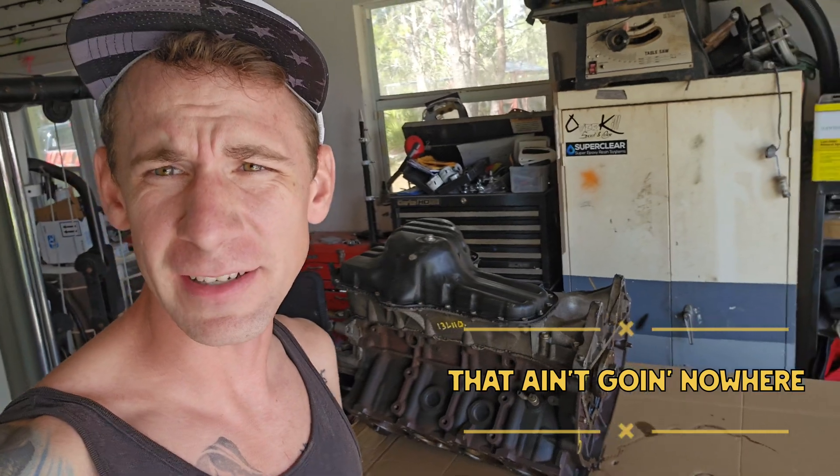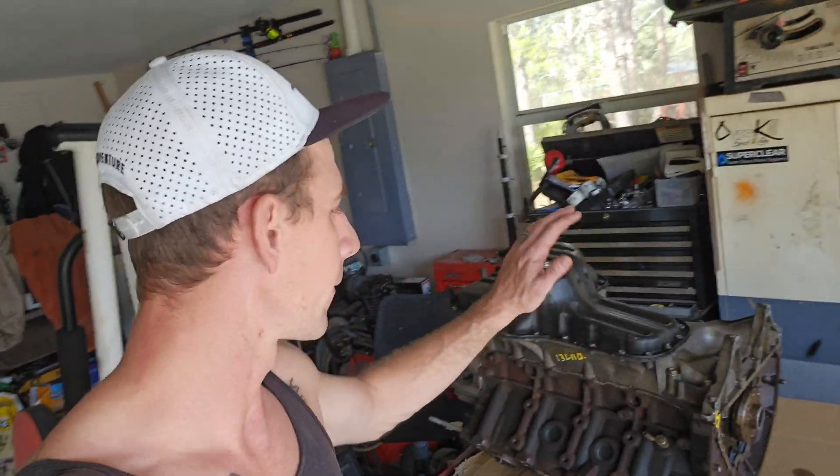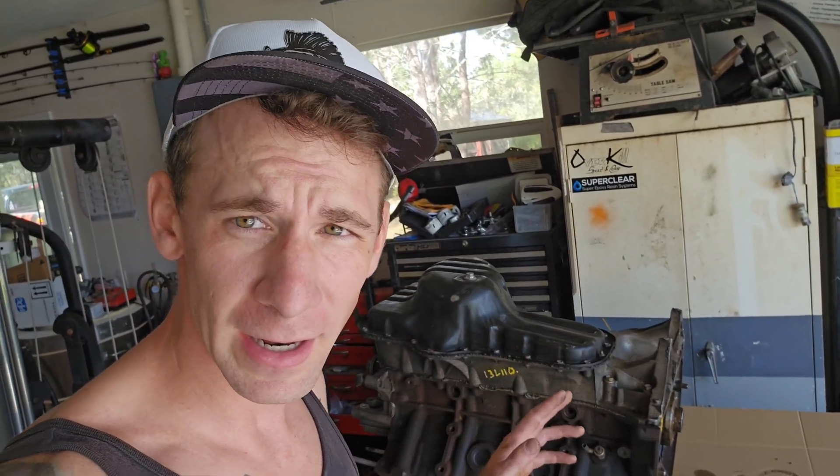Pit viper's off. I have the motor up on the trusty toolbox — don't worry, the Snap-on's held way more than this before. I'm going to get the oil pan off, take the lower section off too, and we are going to take a look. I'll start unbolting connecting rods, roll the block over, pull all of them out, label them all, check all the bearings, then pull the crank, check all the crank bearings, and then we'll tip this sucker up. We'll hone the cylinders and go from there.